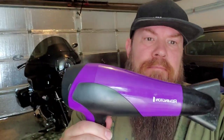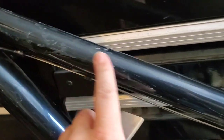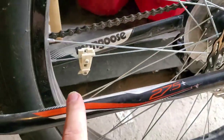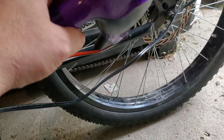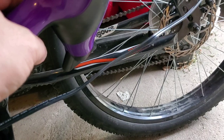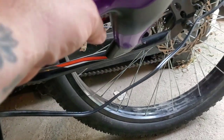All right, so I'm in the garage here with this mountain bike, this Mongoose. I'm actually pulling off all the stickers. What I'm using is a blow dryer — I'm heating up those stickers and scraping off the edge with like an old credit card or some plastic. You can see I've already got a lot of these stickers off. There was a main one here and you're going to see a lot of glue residue I've got to get off. Just turn the dryer on high, let it sit on there for a few minutes — it warms up what is kind of a vinyl sticker and makes it easier to pull off. You're still going to have a lot of that glue residue.